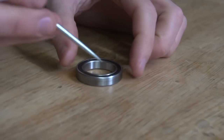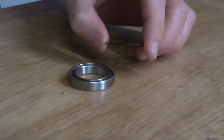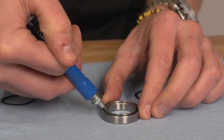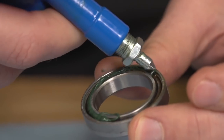Now, some may do this, especially for a time trial like you say, but the majority certainly would not. The reason being is that for a pro mechanic, they'd have to take extra special care because if you're putting oil or a very thin oil inside of a cartridge bearing instead of grease, it's not going to last quite as long because it's going to be able to escape through those seals.